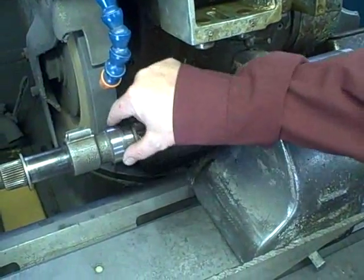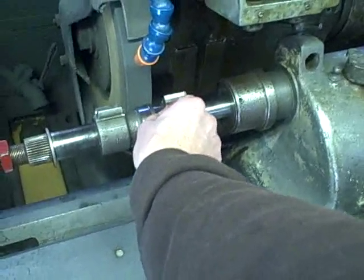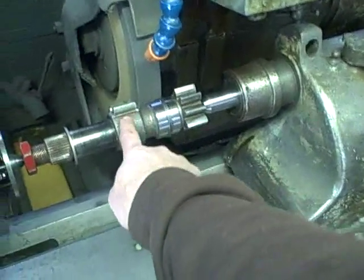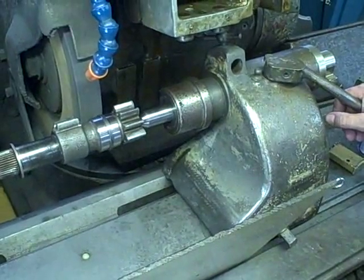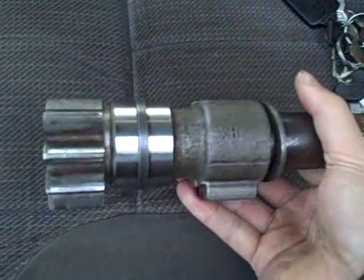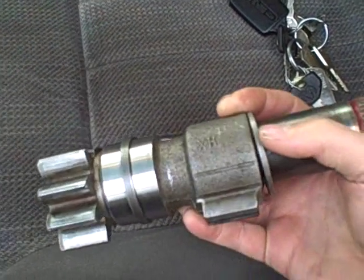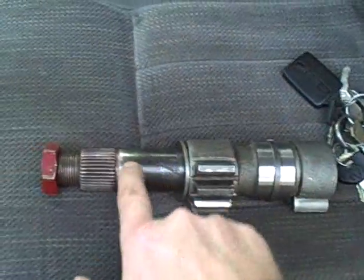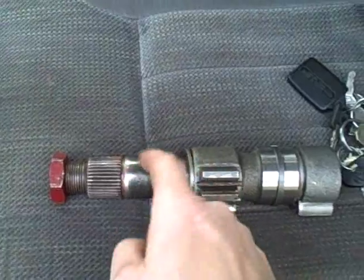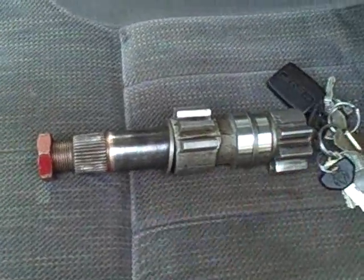It must locate off of that ring, right? There are funny little rollers that actually sit on here and they've got a little groove, so that's what keeps the rollers kind of captive. Hopefully it'll work. I don't have much alternative because this part — they don't make it anymore. Nobody will sell you this part; they want to sell you the whole steering gearbox. And if you did have somebody make that part, it would cost you a lot of money — probably a couple grand. So Wayne told me: go home, try it, and if it doesn't work, they could take a few more thousandths off. They took about 15 to 20 thousandths off. He said this is also out, so that when this is rotating this is also changing, but I'm hoping that with this reground and inserted in the bushing where it won't move, it'll still work. I also talked to him about maybe making a new rack.